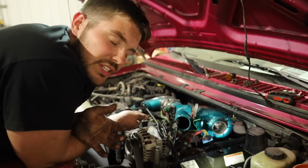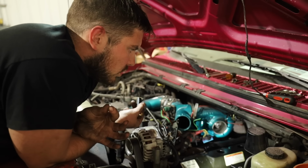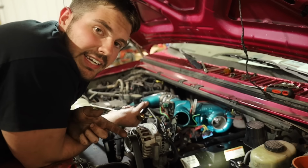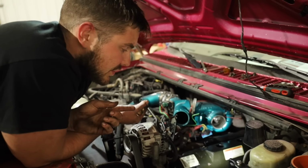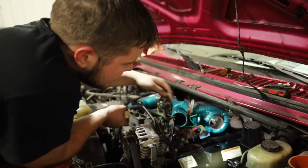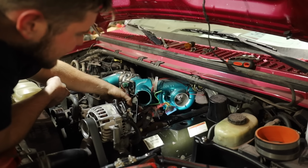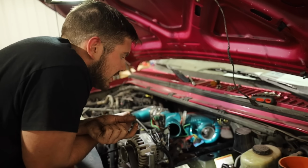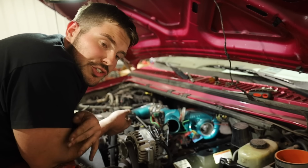But there's a million ways to do this. I think the one that people were very wary about is just cranking the key. But crank the key and don't plug anything in. The injectors are plugged in underneath the valve cover harness, but this isn't plugged in, and this pin connector won't be plugged in either. So pretty much you're just rotating the motor, nothing should fire, and all that stuff should purge.